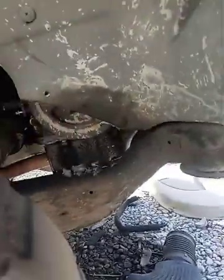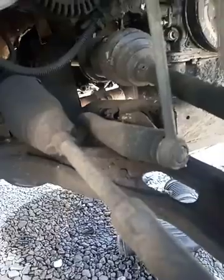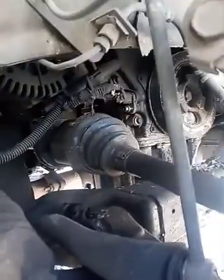I'm going to show you all where the crankshaft position sensor is on here. And I might also show you where the camshaft position sensor is. The alternator is back here on these cars, all the way at the bottom of the firewall. It's got to come through this little bitty hole, which is doable. You have to get it from underneath and pull it out through this small hole to get the alternator. It's three bolts — two on the bottom and one at the top.